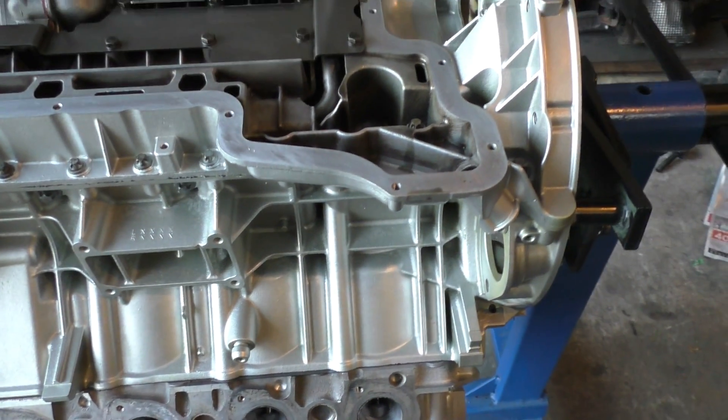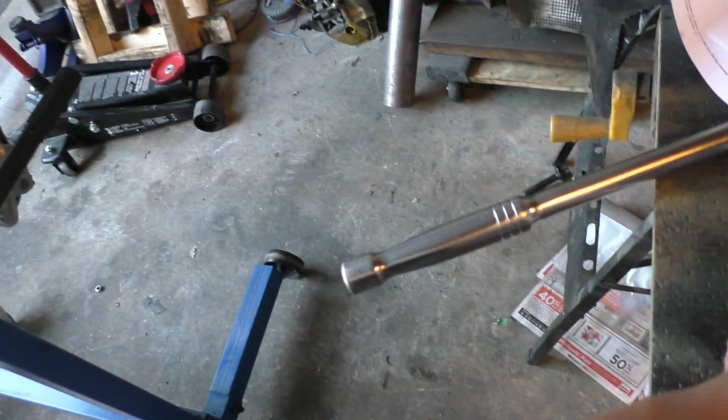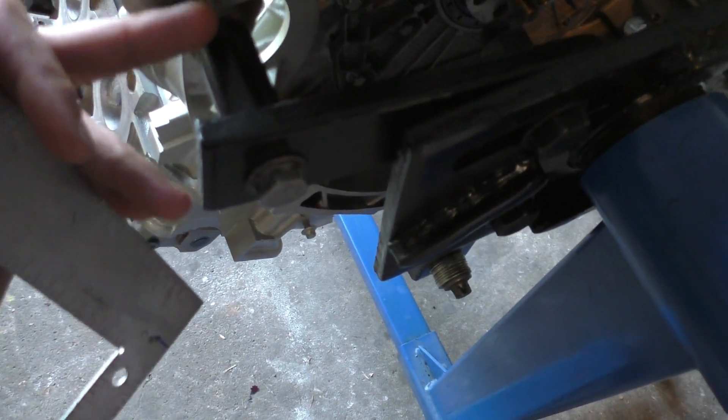It's time to put the lower oil pan back on. A few things I forgot to mention in the previous video that others pointed out: when installing the upper oil pan, make sure it's level with the engine block — if these things aren't matched, when you're bolting the transmission on the bolts might not line up or the transmission might not sit flat with the block.